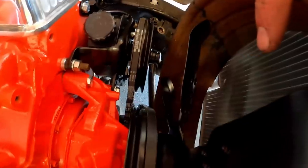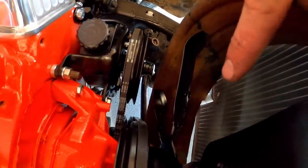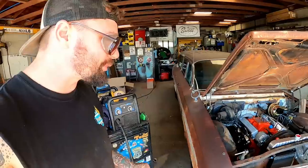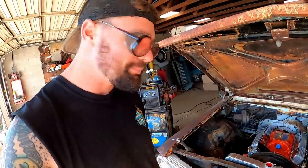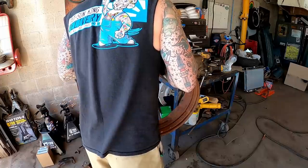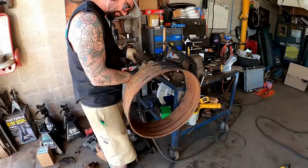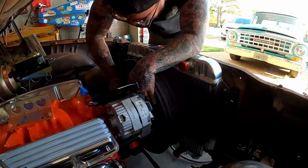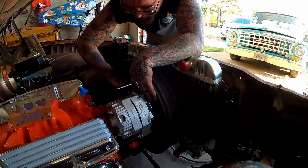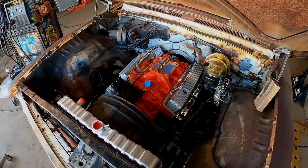Well, booger. It's tightening the fan down, and then I notice our shroud's rubbing our notch tank thingy down there. We do not want that rubbing through, so we're gonna have to mark where it's hitting and then pull all this back apart and notch the shroud. Fan's on. We're notched and clear, and that's good. And she's almost starting to look like something.